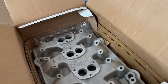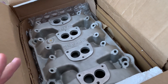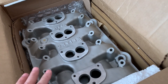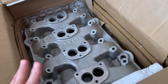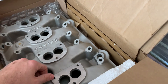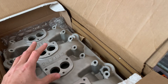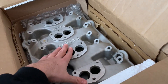Before I get comments saying I'm crazy for putting four carburetors on — number one, the current setup of two Stromberg 97s is really strangling that engine to death. One Super 97 carb flows roughly 200 CFM, so a 354 cubic inch engine would really be happy with around 750 CFM.